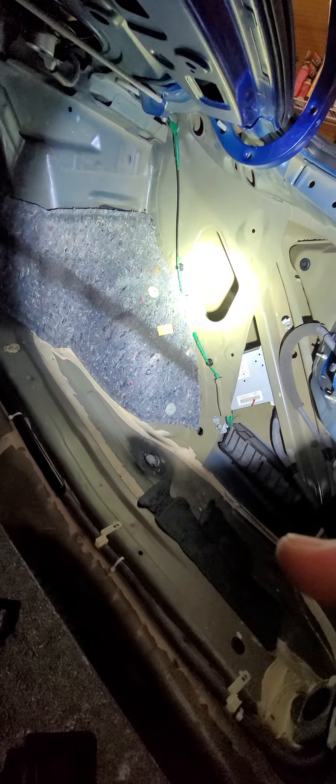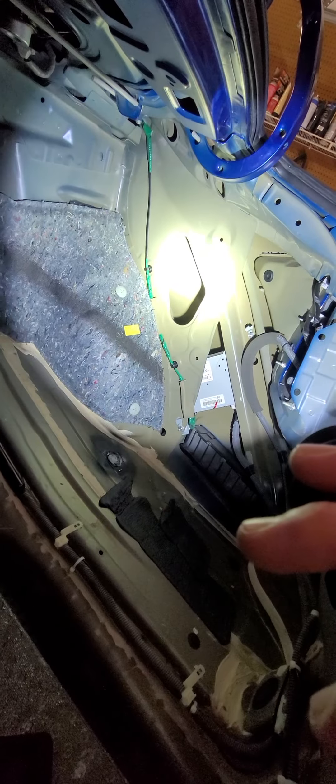Let me show you the trunk. I've got the panel out on this side — this is the side the box is going to be on. I am putting some sound deadening material on the inside of these metal fenders and basically anywhere there might be a tinging or a vibration on these metal panels back here. For my ground, there are three bolts here — I'm going to use this back bolt right there as my ground. That goes through a couple different metal pieces on the body and there's no paint on it. Between this whole bracket being grounded between these three bolts and into the body, I'm going to use that ground. It stays hidden behind the cover when I put it back in and you'll never see it.